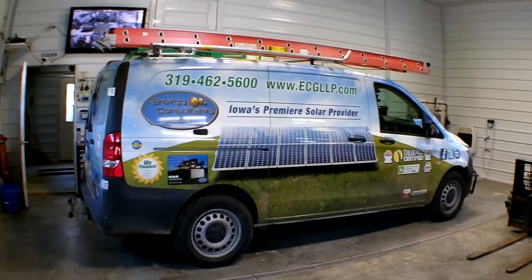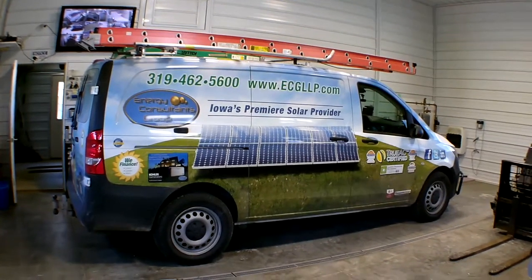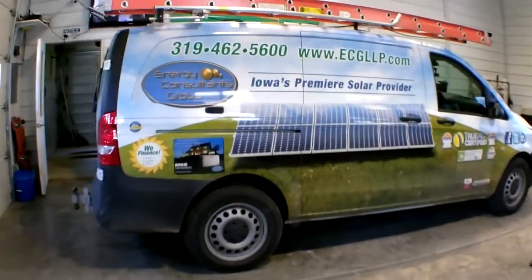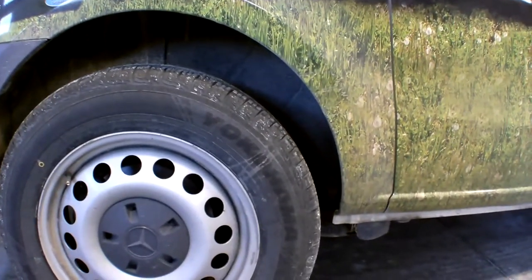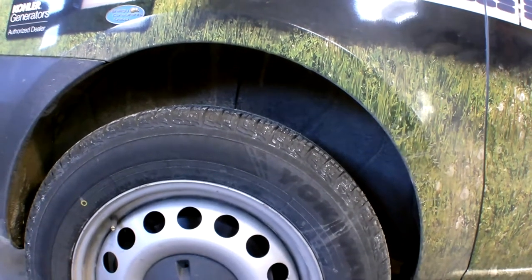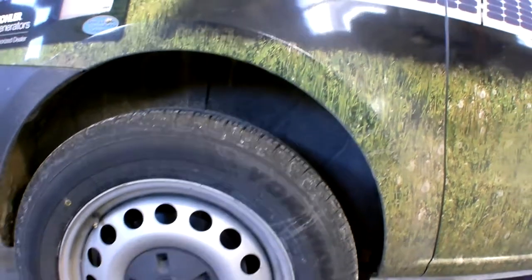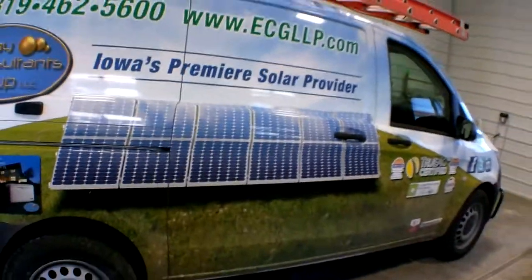With the tires and the lift kit it was about $1,800, and obviously when you take apart your suspension you need an alignment, so that cost is included. What we put on were Yokohamas — specifically 225-65R17 versus the 225-55R17 I had before — so it worked out pretty good.